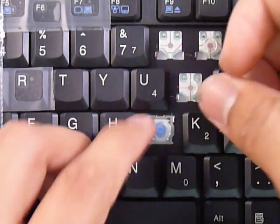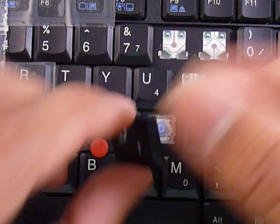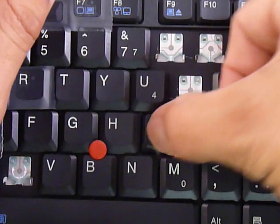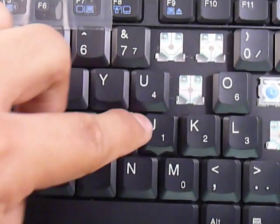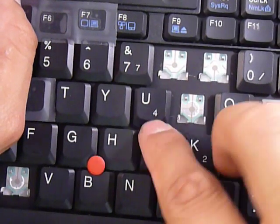Stretch the hinges upward in order for the hooks to grab onto the top pins, just like that. Then get your keycap, put it right in the center, and push down evenly on all four sides. If it stays down like that, you just have to pick it up once, and after that it will be fine.